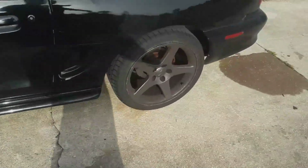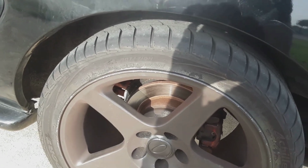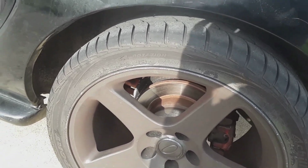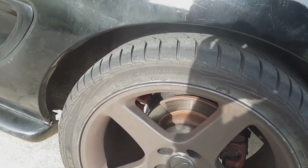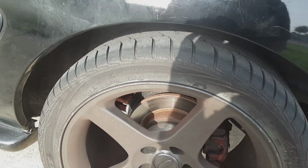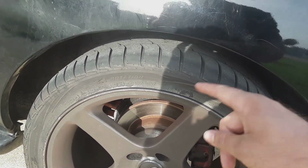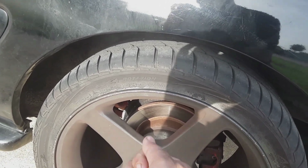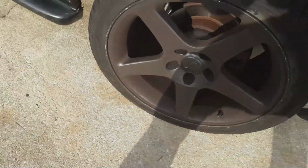Now, another thing that my dumb butt didn't realize until I watched the video: you can undo the shock. You can undo the quad shock if you still have it, and raise the car up as high as it'll go. The rear end will actually drop low enough that you can just push down on one side and get the spring in and out. So instead of trying to put the lower control arm, which is right here, on with the spring and using a jack to compress it, trying to get everything lined up, put your upper and lower control arms, get everything lined up, and then with the shock and the quad shock unbolted, push one side down as far as you can go. I just got my wife to step on one side, and I slid the spring in and then went to the other side and did the same thing. So that makes things a lot easier. I'm sure a lot of y'all know that, but I hadn't ever really dealt with that before.